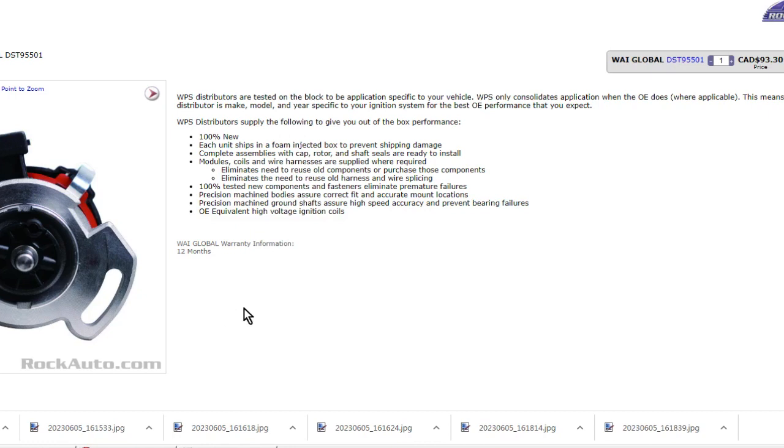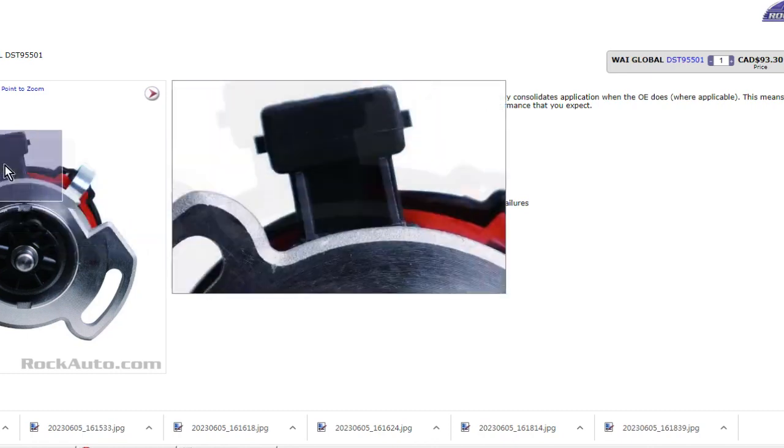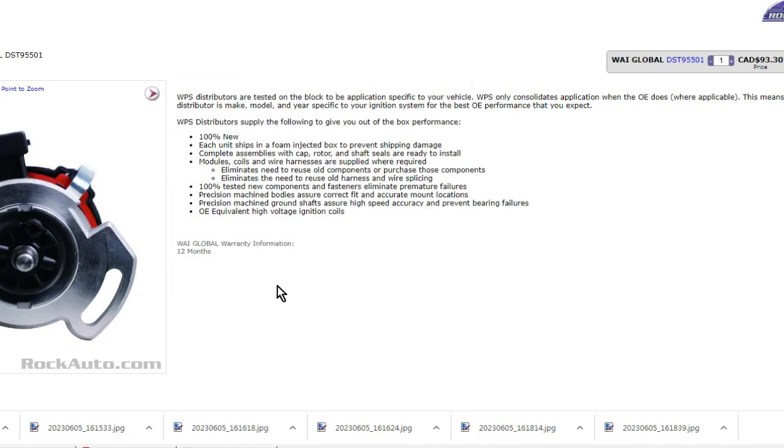In this case, when the vehicle acted up, or when the sensor gets hot, either the car doesn't start or it somewhat misfires trying to start. There are various symptoms, and as it cools down, it'll start again. So anyways, the customer was experiencing some of these symptoms, and so they figured, let's just buy a distributor, the quickest way to go. Put in the new distributor, and the car is good again. Well, as it turns out, let me just switch screens here.